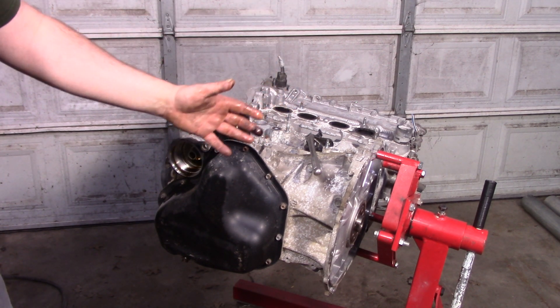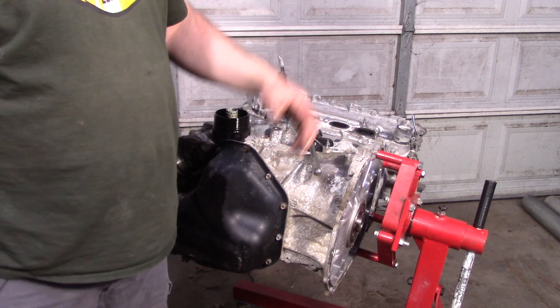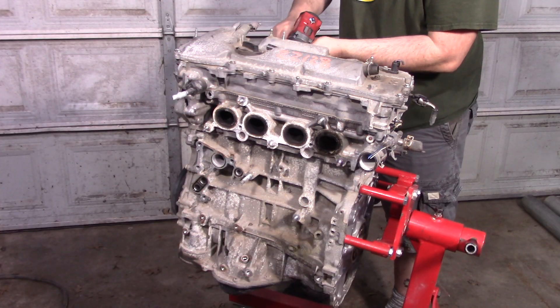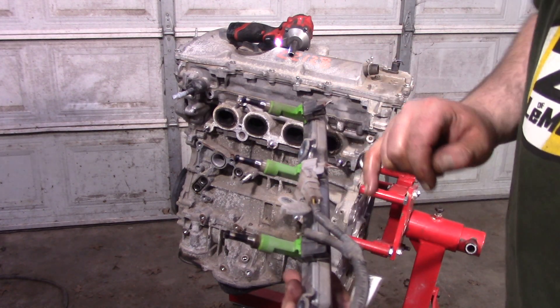If it was on its left side by quite a bit, then the oil could make it up. I think we're just going to send it. Let's take a look at the valve tray next. You can see on the injectors signs of EGR.